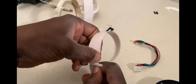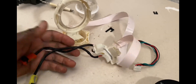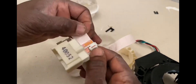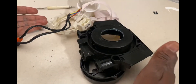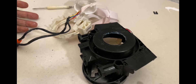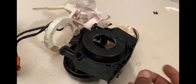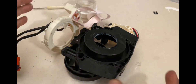This is exactly how it works. When you have a horn that doesn't work or the airbag light is on — on Nissan specifically — with the clock spring, some cars also have a steering angle sensor built in that is no good. The whole problem is that this wire here broke. It's not easy to fix because sometimes they break here, sometimes somewhere else. The good news is it's not expensive — available on eBay, Amazon, websites — maybe 20, 30, or 40 dollars. The dealer sells this one for almost 160 to 300 dollars. If you adjust the steering angle sensor code and the code keeps coming up, you may have to open it and change only the sensor, or replace it completely.